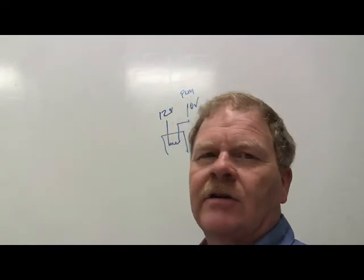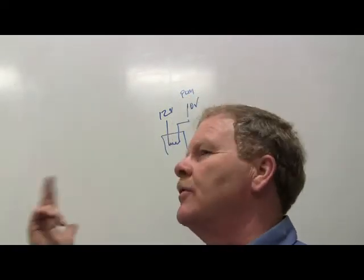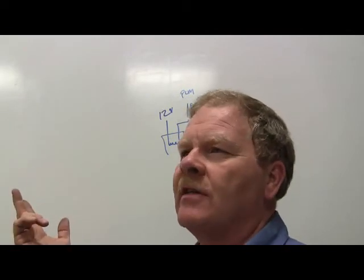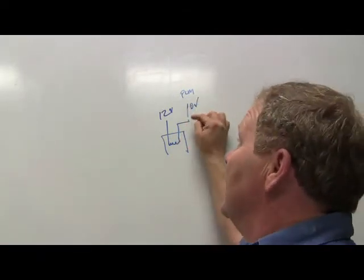On your oxygen sensor, it'll be the 2 white wires, the 2 brown wires, or the 2 black wires. It's always the 2 wires that are the same color as the heater. It's supposed to have about 3 or 4 ohms of resistance. But the long and short of it was, this one didn't have it.